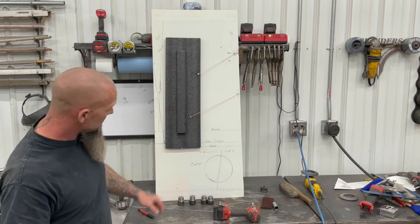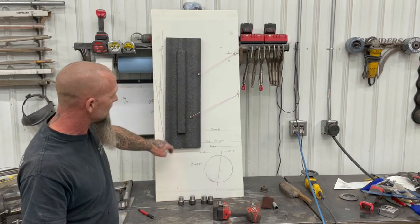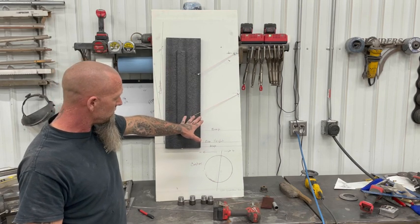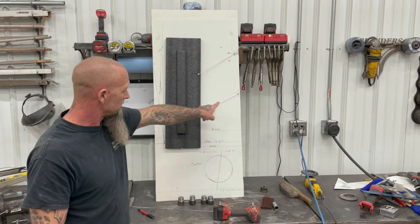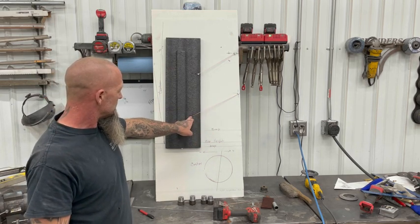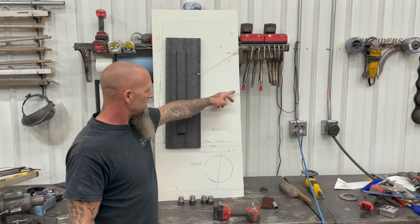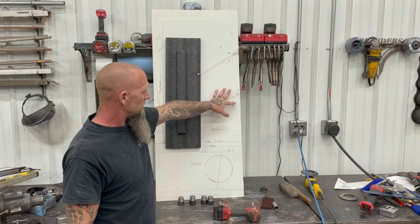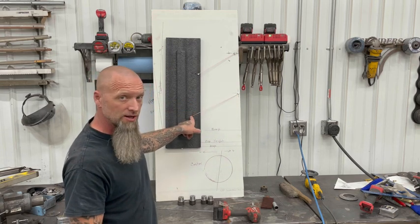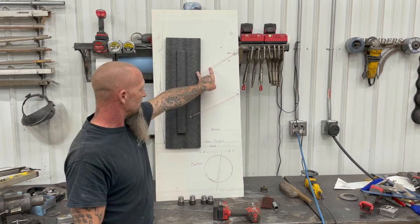That's about it, guys, when it comes to setting up like a wishbone front end. Deal with what you have to. Your lower is just going to be set. This is going to set if your tire fits inside your fender or not. You might have a little bit of up and down that you can go here, but this will be the first arm that you set. After this arm's set, then you come in and you figure this one out.